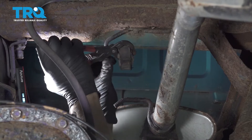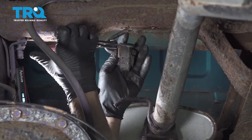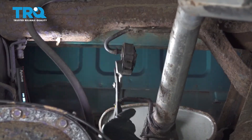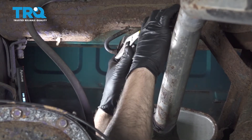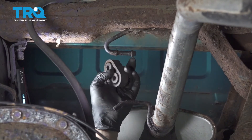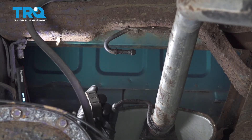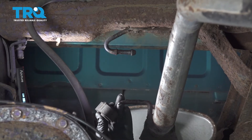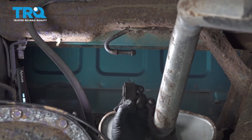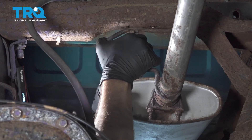We're gonna work the upper hanger, the rubber bracket. We are going to remove the rubber hanger from the upper support. The reason why we're pulling it off the upper hanger is that it is a straight sleeve right here — trying to stretch that rubber hanger down around this bend is very complicated. So I'm gonna go ahead and slide this over the bend, lift up the exhaust and work that onto the straight sleeve.